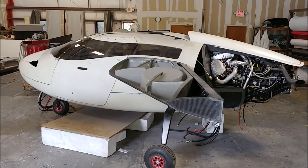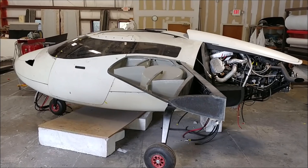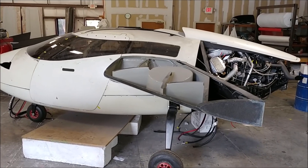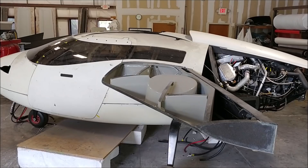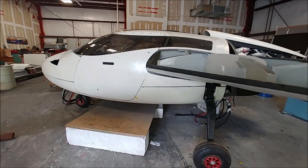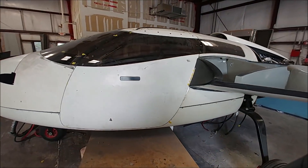I figured out why we were getting the door seal leaks — mainly because of the expansion of the cabin. The A-pillars actually expand as much as a quarter of an inch, which is just enough to allow the seals to break. I've made some adjustments and worst case scenario we should still be able to hit around four and a half PSI, which at 25,000 feet would give us a 10,000-foot cabin — at least for the prototype. The door redesign for production will address this properly.